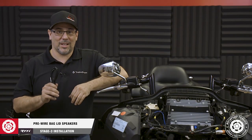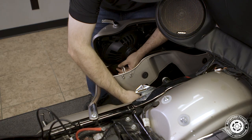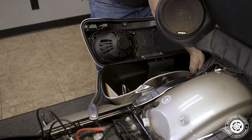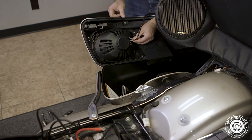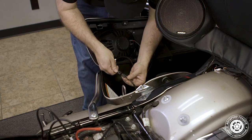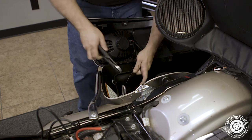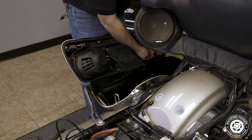We're almost done and now we're ready to wire those bag lids. To get started, we'll position our bag in place and insert the grommet into the 3.25 inch hole. Once you have the grommet seated, finish securing the bag in place. Once that's done, use the pigtail harness included in the kit and connect the red wire to the positive terminal marked with the red dot and the black wire to the negative terminal. Then plug that pigtail into the main harness. We've included some zip ties, zip tie mounts, and retainer clips to keep the wiring out of the way inside the bag. We've also included some replacement warning stickers for installation in your bags.